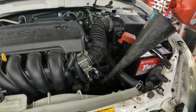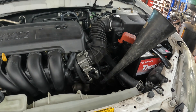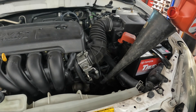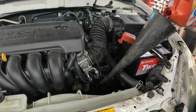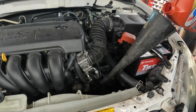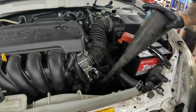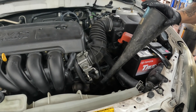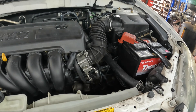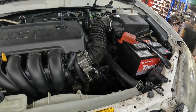If it's your first time draining it, just put two quarts in and then check it, because you don't want to overfill it. Too much fluid in a transmission or engine is just as bad as not enough — it starts to aerate the fluid and can cause cavitation and windage. Especially in the engine, windage is a big horsepower robber, and if it's cold outside it can really make it hard for the engine to warm up properly.